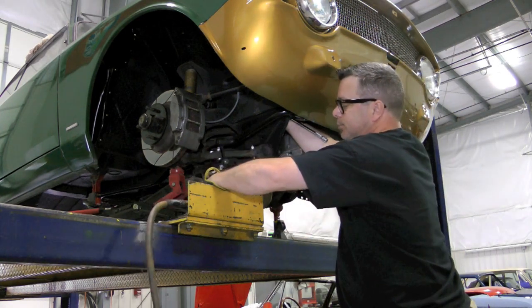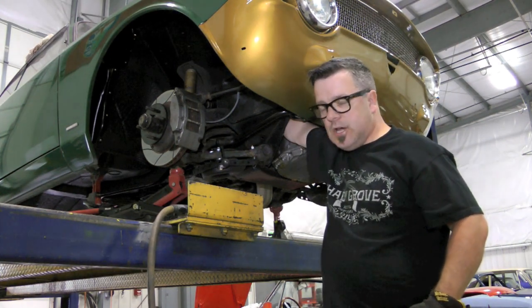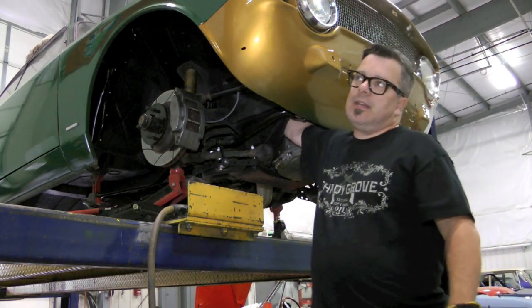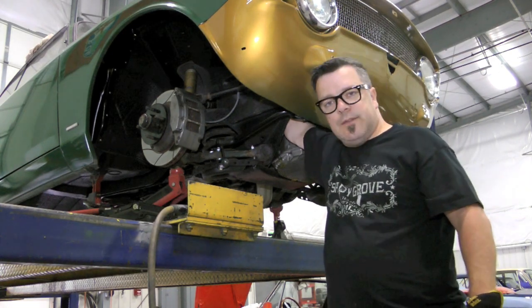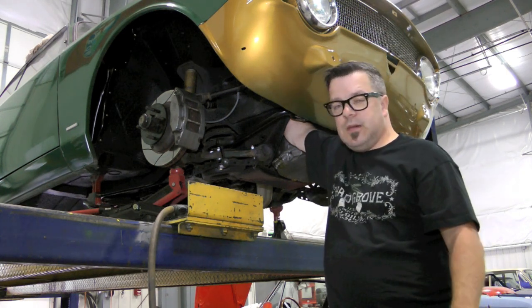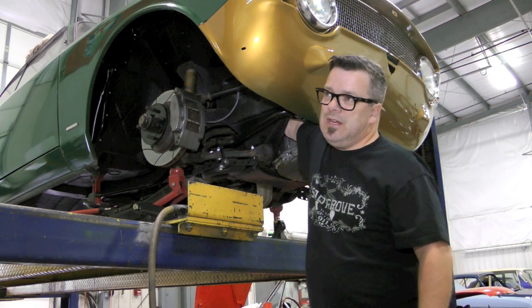A little bit of disclaimer: getting the crossmember pins out is not a hard job, but they're pretty difficult to get to. If your battery is located in the front of your car, be careful and consider disconnecting it because you come very close to the high voltage wiring to get to these pins. On this side, if you have an early car, you have your fuel filter, fuel lines, and the bottom of the carbs up here. Be careful of all that and use the minimal amount of force needed to get these out.